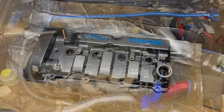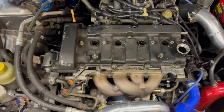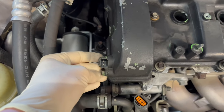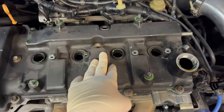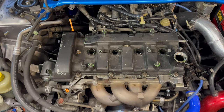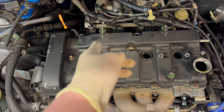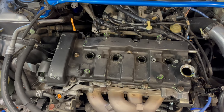All right, I went ahead and painted all my hardware after finishing up that valve cover. This is the factory one — as you can see it's pretty beat up. Here to swap over: the cam position sensor, the ignition coils, and the PCV valve. You'll need a 10 millimeter socket and you'll need to take off 11 bolts all the way around. I'm going to go ahead and get to swapping this over — I'll put you guys in the time lapse and catch up with you afterwards.